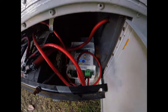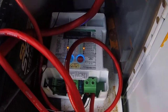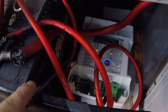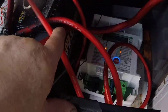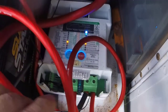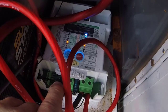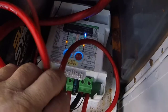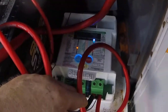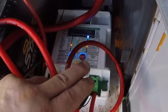Out here is my charger for the house batteries while I'm driving. It charges off my 12-volt start battery, steps the voltage up to 24 volts, and then goes out to my house batteries — because I have a 24-volt system. I had to search quite a bit to find this; it's made by a company called Sterling Energy, but it was quite expensive.